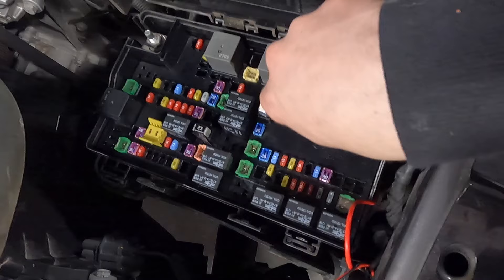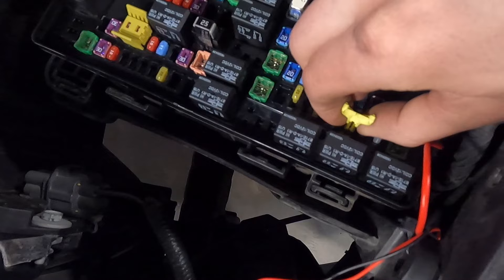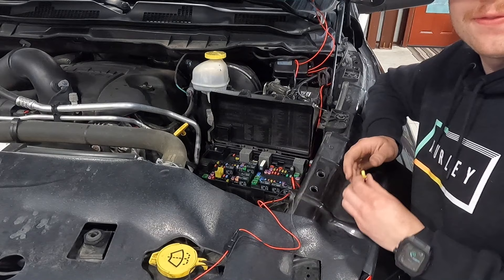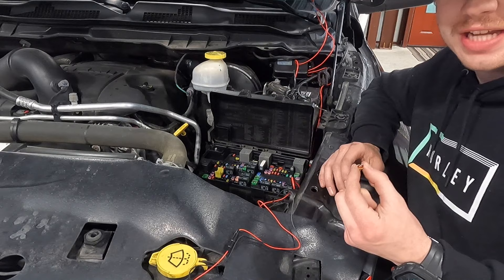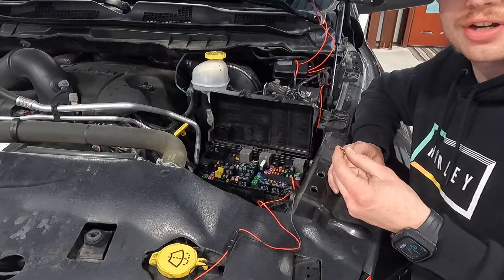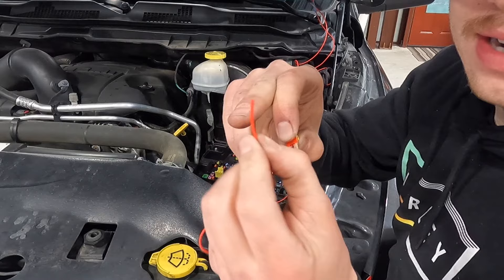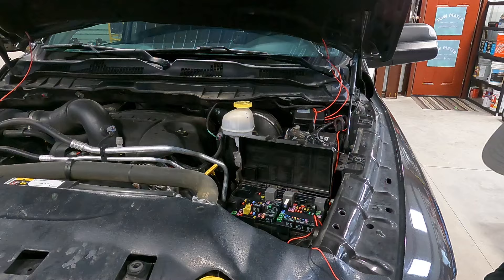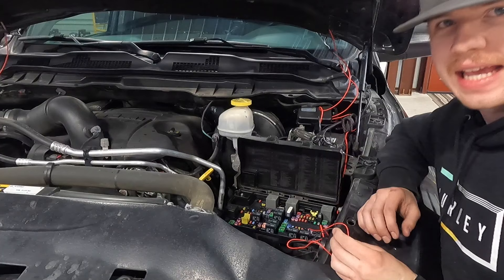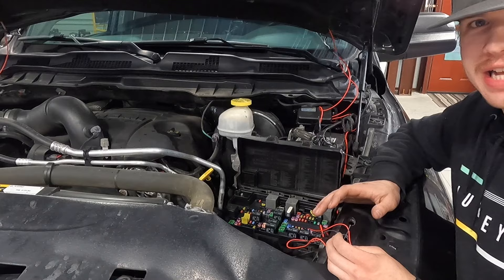In my fuse box it comes with a fuse puller right here — when you take it out, it pinches the fuse a lot easier. I do have some fuse taps on order; that is the right way to do it, but they haven't been delivered yet. So for right now I'm going to show you guys the lazy way to do this — I do not recommend doing this. I'm just doing this temporarily until my fuse taps get here, then I'll do it the right way. So order some fuse taps — I'll put a link in the description. The lazy way is to strip this wire down so you have a little bit more showing, just wrap it around one pull of the fuse and put it back in. The red wires are power, the black ones are ground. Please do not do it that way — it is just temporary. Please use the fuse taps.